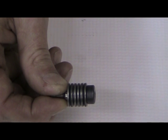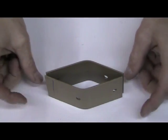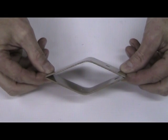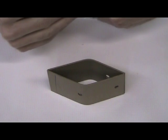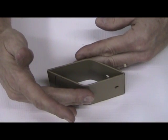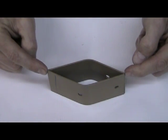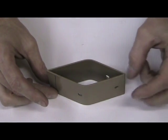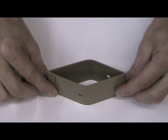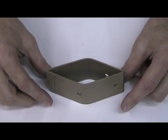I have a sample here to show you in a little more detail. These two items in front of you — I bent two pieces of steel to simulate two springs. As you can see, the two edges of the springs make contact. When the shoe engages, it tries to flatten the spring. The two corners here that are sharp are actually like two fingertips touching each other. At any given time, especially from centrifugal force, these two springs can misalign. Every time those springs misalign, you create a different spring pressure.